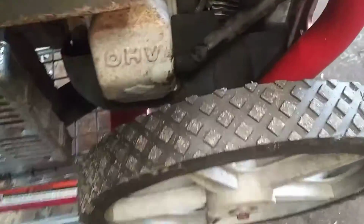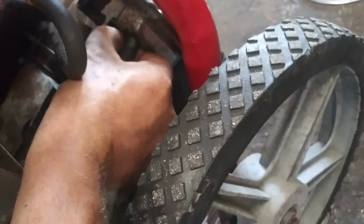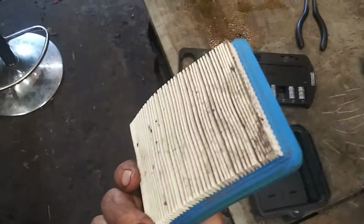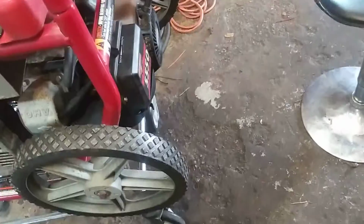Alright, now we're going to go ahead and hook this tube. This is like a breather line from the crankcase, like crankcase ventilation. We're going to push that right back into the air filter cover. May take two hands as well to get that in there. Then we're going to make sure the air filter is nice and clean. Bang it on a table or something, make sure there's no debris in it, blow it out with air. If you have to replace it, I'll have that in the description as well, so you can get a replacement air filter for it. And then put it in the air filter cover and put the cover back on. Now we got all this set together.